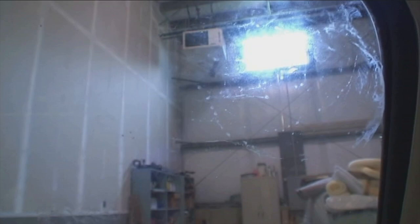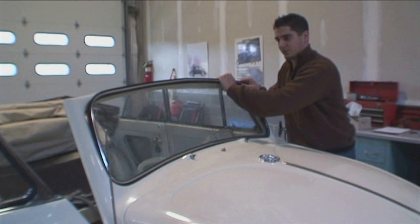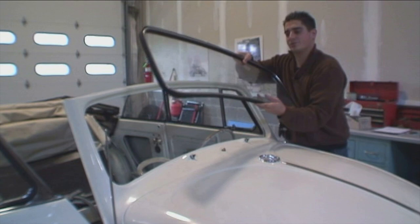So as you can see here, I've popped the seal out of the inner lip — you can see the inner lip came off. I was able to push it out all the way around. At the bottom portion, which is still in, you just push it out and then pull up on the glass. Now that I can get my hands behind the top portion of the window, it'll just come right out just like that. It's really the only way to save these windows without breaking them — we've broken plenty in the past and learned our lesson.